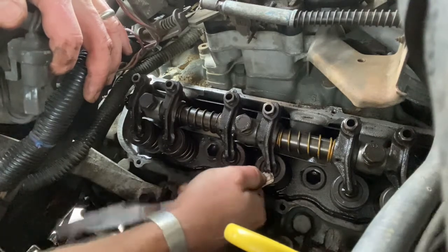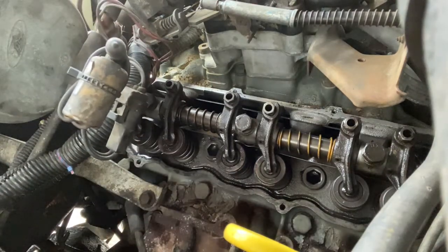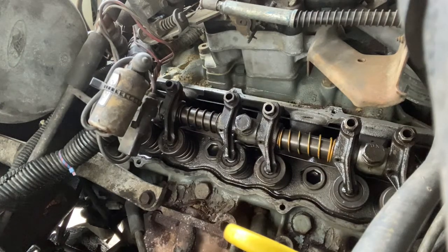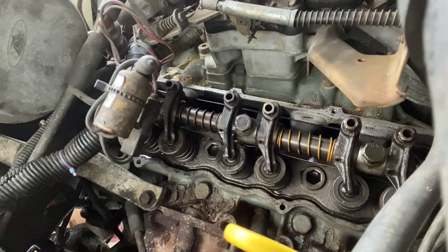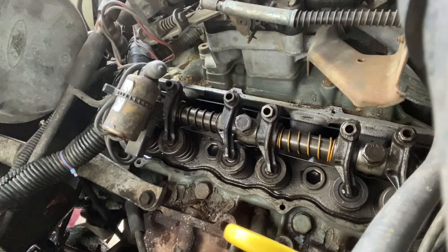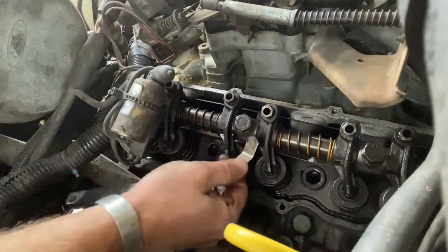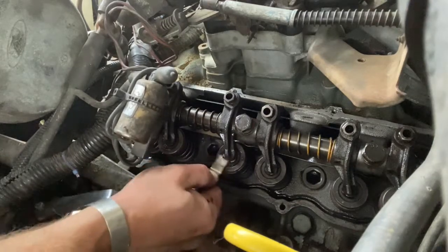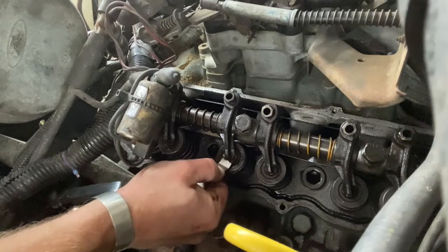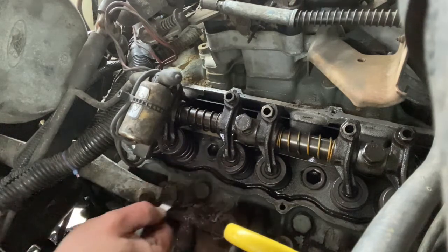That's too tight, so that one's probably still not all the way free. That one is going down. This one right now feels good. We're just going to turn the engine about a quarter turn and check each time until we can get the maximum amount of lash on each one and adjust it down to 15. This intake is now down, so this should definitely be open all the way. Oh yeah, that's a lot of lash - there is no drag there whatsoever. That's definitely part of our noise. I'm going to go grab a wrench - should be seven-sixteenths.